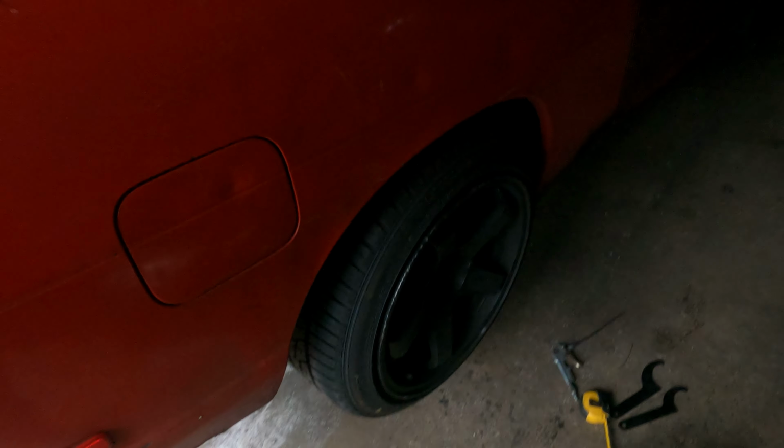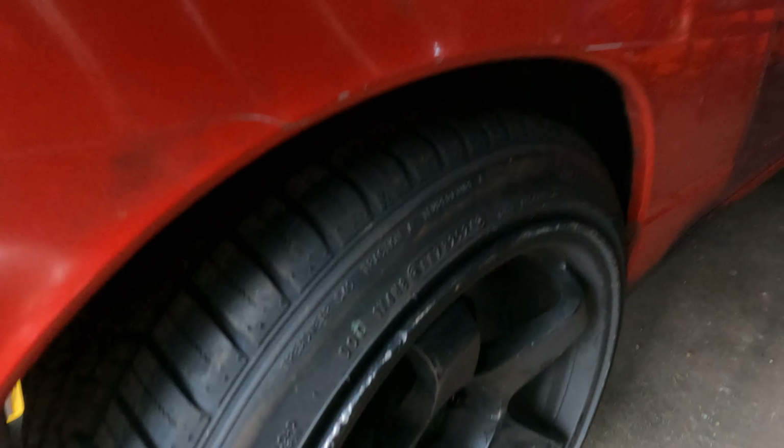All right, so we have the coilovers adjusted. I raised it about 3/4 of an inch to an inch in the rear. Hopefully that's enough. I was tucking before and I'm not. I have a decent wheel gap now. I think the front needed to be raised more than the rear because it was scraping up here, coming off the header. So the front needs to be raised more.